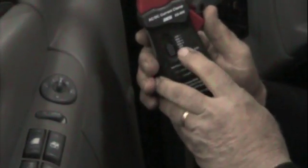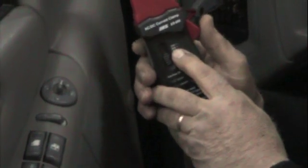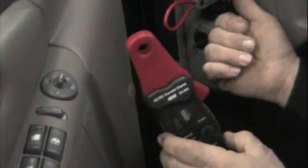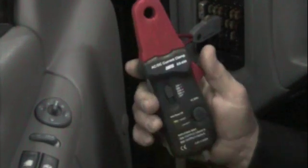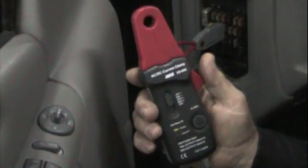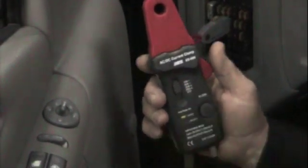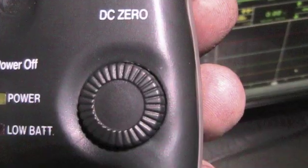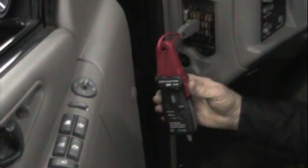Which one do you set it on? If you're looking at a digital signal, use the bottom two. If you're looking at an analog or sine wave, use the top two. Do you use 80 or 20? The easiest way: what's the size of the fuse you pulled out? We pulled out a 20 amp fuse, so you should move this up to the 20 setting. If you were on a circuit that was more than 20 amps, you'd need to go to the 80 amp setting. Once you get it turned on and set, push the zero tab so that it will zero. Do all of that before you hook it up to the wire.